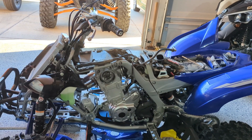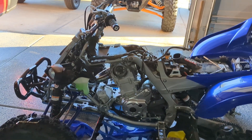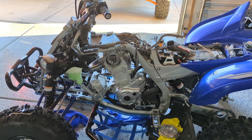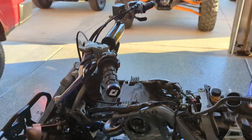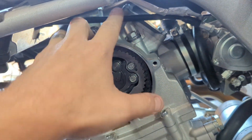What is going on guys, Joe from Odyssey Off-Road. Real quick, just wanted to report — I got about 70 hours on my Raptor, never checked and adjusted the valve lash, so I took it apart today. You got to take the gas tank off to get to the intake valves, which are up under this cover here.